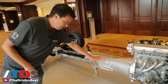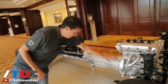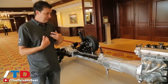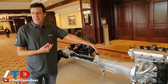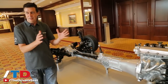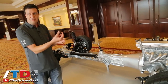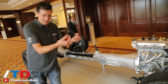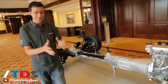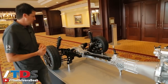You notice this is a show piece that's been buffed and painted, so you'd think the real one probably has a bunch of ribs on it for stiffening. That's what I thought too, until I saw the real transmission — there actually aren't any stiffening ribs on it. Instead of using that old technique to stiffen the structure against vibration, they actually vary the wall thickness of the castings very subtly in different places to adjust the natural frequency of the part. It's a really advanced technique that lets us shave grams here and there to really get the weight down.